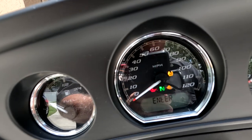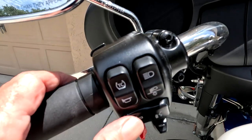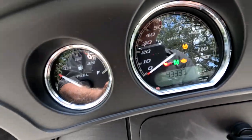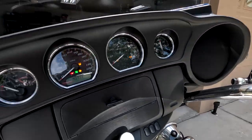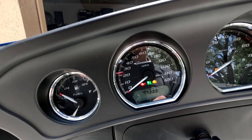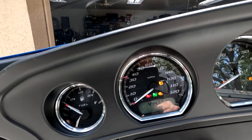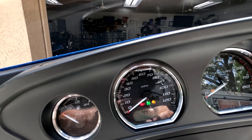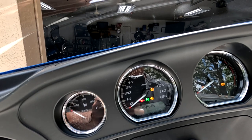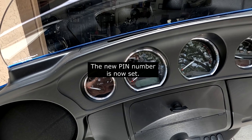It's now telling me to enter a pin. Press it one more time and the numbers show up — right now they're all set at three. The left turn signal is what changes those numbers. So I'll make it four, then press the right signal to switch to the next number. We'll make that a four as well. Press the right turn signal again — notice it's flashing — press to four. Repeat for each digit until we've got all fours. Press the right one again to confirm, it goes back to the original number. Then shut the ignition off. Remember: when setting the pin number, you've got to have the key fob in the bike.